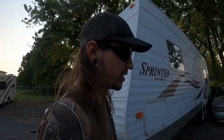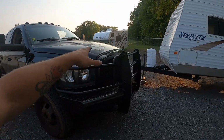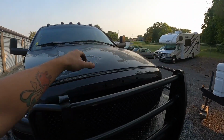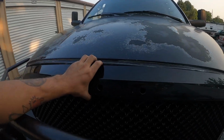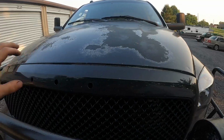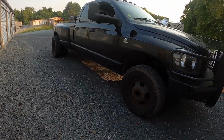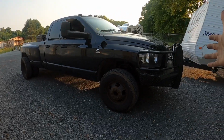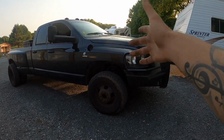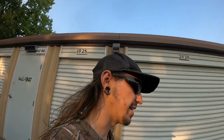I also need to go get coolant. We're gonna flush the system because I think I've gotten rid of all the coolant leaks, but what's happening is with just running water, obviously it boils at, I think it was 212. Also, I need to get a new grill. That's on the to-do list. Get one of them at some point. But I believe with the coolant boiling at 212, it also heats up a lot easier, and I think that's where we're blowing all our coolant out. So I don't think there's any leaks left, but let's take it one step at a time.